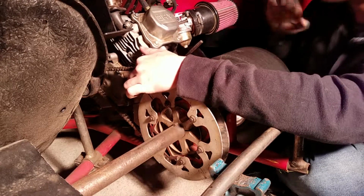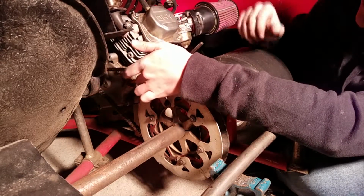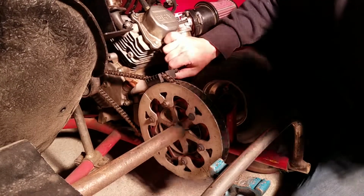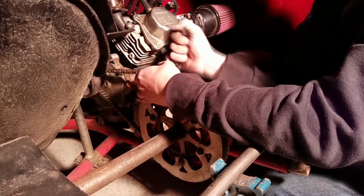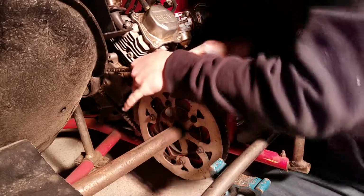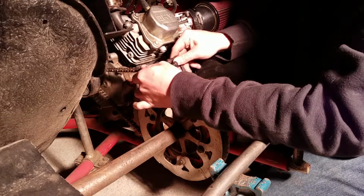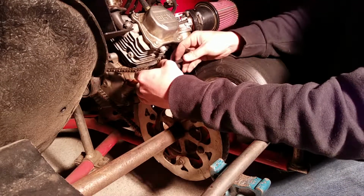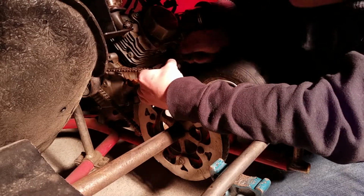But yeah, so the motor's not far forward enough or different or something. So this chain was adjusted to where it would actually be the right length, obviously. But it is no longer that length. Come on, baby. And my dad and my uncle never put a master link in because apparently master links are for pussies. So I gotta remove it in the old school way. This chain's kind of nice, actually. So we can get to ripping.